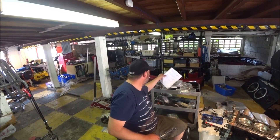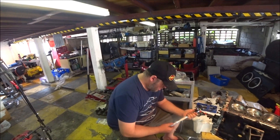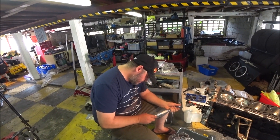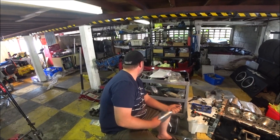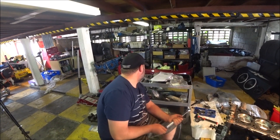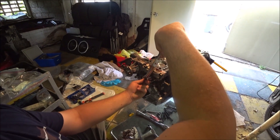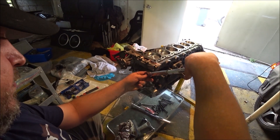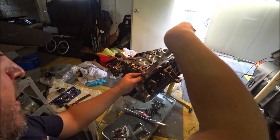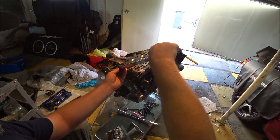What's the final torque? M8s are 16 to 21. So we're just doing the final torquing of the water pump - I've chucked a couple of ancillary items on, been too busy doing rather than filming because I have to get it all done. Final torque for this is 16 to 21. Correct sequence - goes around. So I took these up a stage and then wait for the RTV to dry a certain amount.